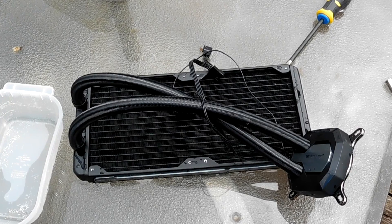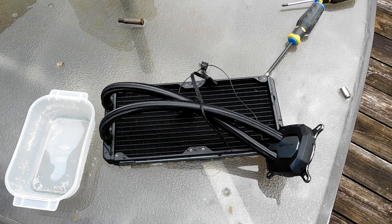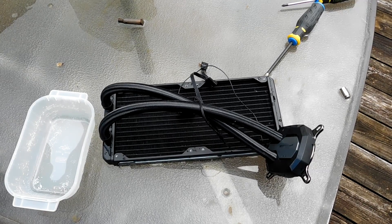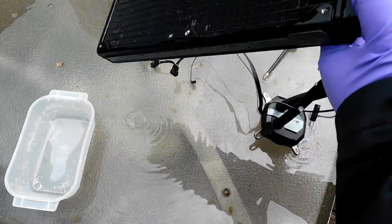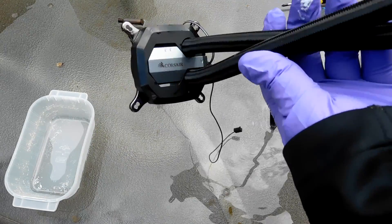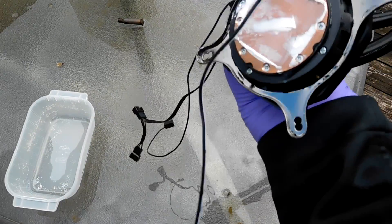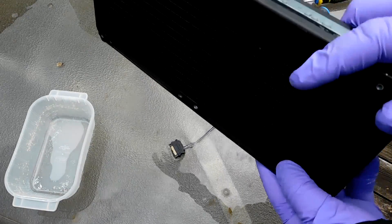I've tried to fix it doing a couple of basic steps like twisting the tubes and trying to free up any loose crap that could get in there. I put it back in the system, powered everything back on, and it wasn't working still. I think it's acting like there's a clog somewhere in the radiator. Corsair Link told me that the pump is acting just fine, so I don't think it's a pump issue. One of the tubes on this cooler would get extremely hot while the other one would stay pretty cool.